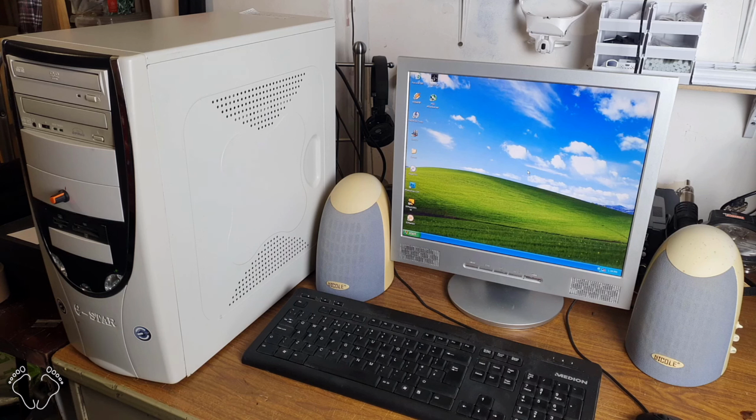So I did all the usual troubleshooting steps, changed the RAM, tried powering it with nothing plugged into the motherboard, etc, etc. And I came to the conclusion that the CPU had died, which I know is very uncommon. It was either the CPU, the motherboard, or the power supply.